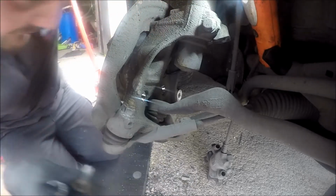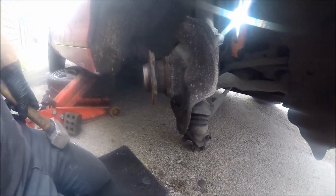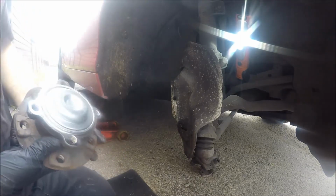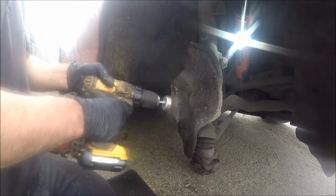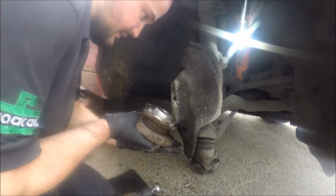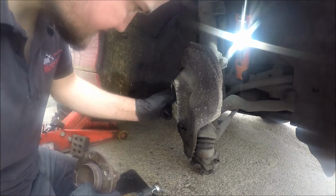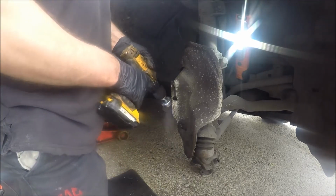So that means all our bolts are out. So let's grab you back round here. Move you there. Just literally like that. So all you need to be careful of then is that ABS sensor. Leave the ABS sensor where it is. I spoke too soon now, by the way. You've got that little tab, there's rust on it, which will locate in that tab there. Need to hit it off that way so you don't come into contact with the ABS sensor. I've got no damage on mine, so we're good about that. We'll clean that up before putting it back together anyway with some brake cleaner.